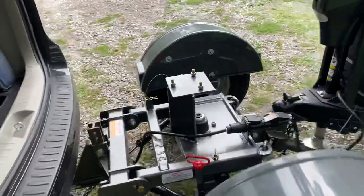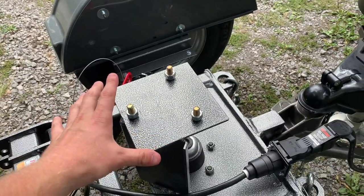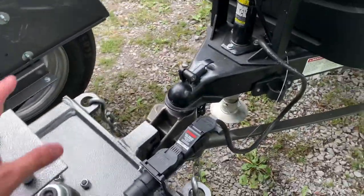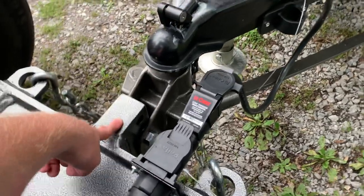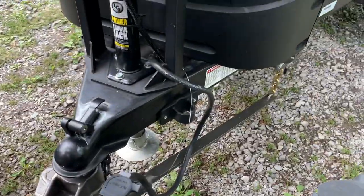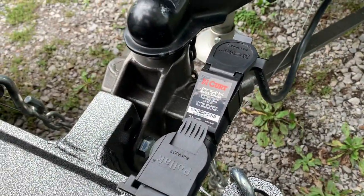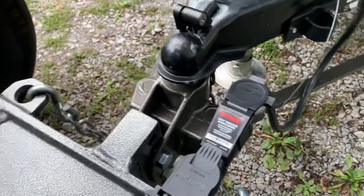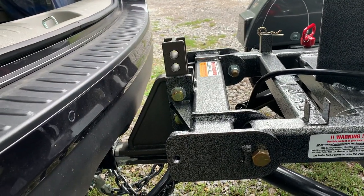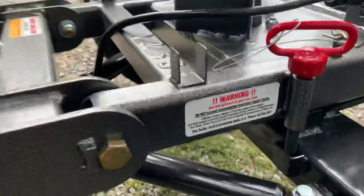You can see how this is set up — the spare tire sits here, but I took it off. They're fabricating a bracket that goes six inches back so the spare tire will actually be sitting further back rather than here. There's also going to be a six inch extension which is going to push this back six inches so I can make tight turns reversing on the pivot point. And of course there's my little Echo wireless brake controller — best thing ever. We also have a rise kit from Blue Ox; I had to buy that separately and it was ridiculously expensive.